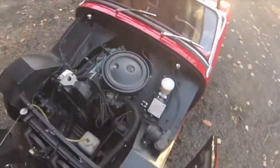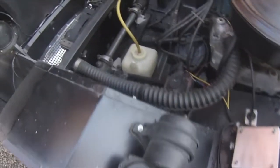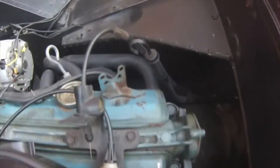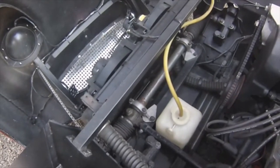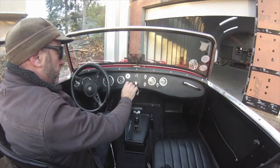We see a lot of modified cars, not nearly as nice as this one. He's got a two-speed wiper motor there from a later Sprite, and also the later Sprite brake master. You can see there where the tunnel was cut away a little bit — that's why we lost the heater and the battery shelf. But there's an alternator and a header and nice easy-to-work-with GM stuff, and an ample radiator. And the lever shocks are still there too. It just works, and for that I'm really impressed.